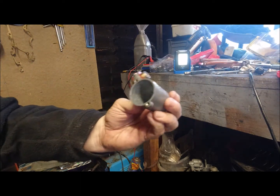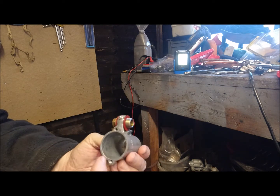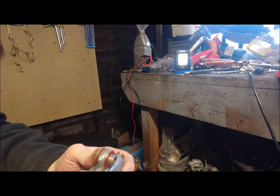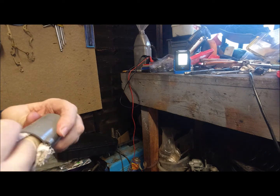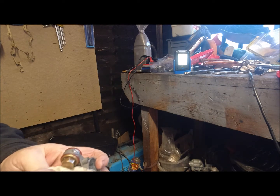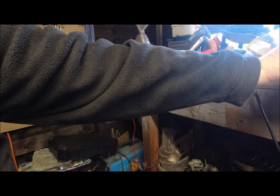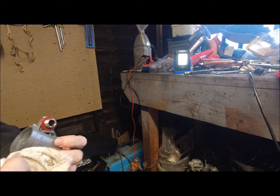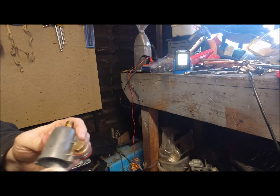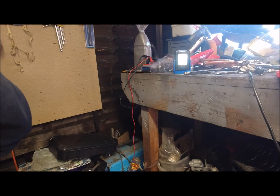And if we look at our filler chamber, that's nice and clean, and our well must be clean because we just pulled the rod out of it basically, so that needle goes through that jet and it can't get clogged up with the needle jet. It can get smaller and it can fur up, but with it being open as it is at the moment, crystal clear.